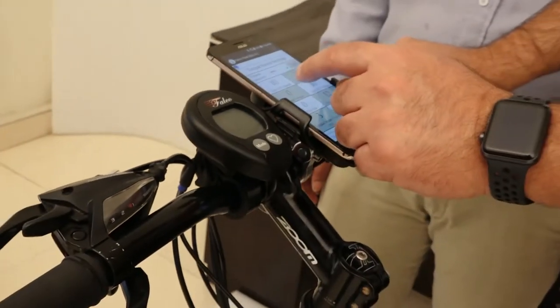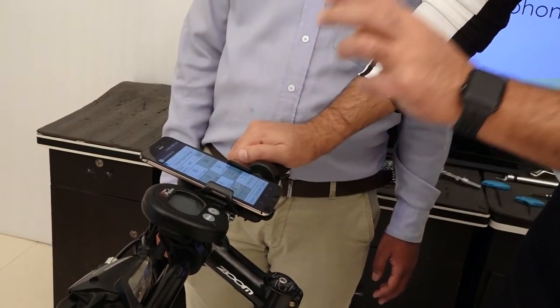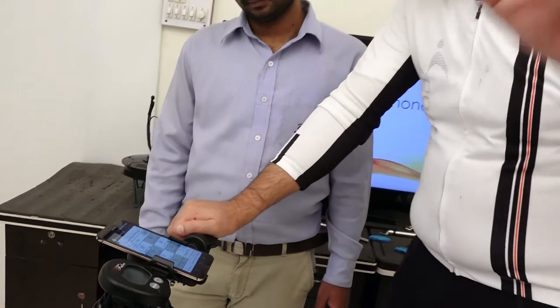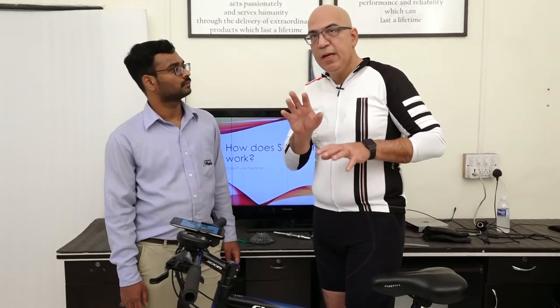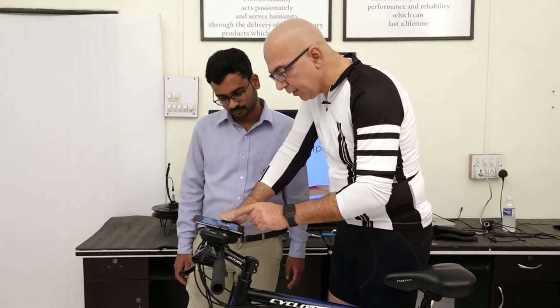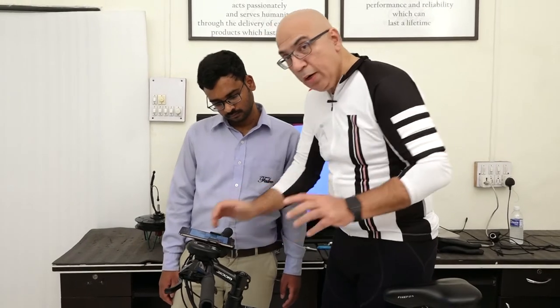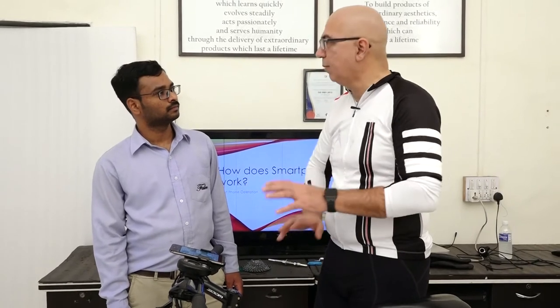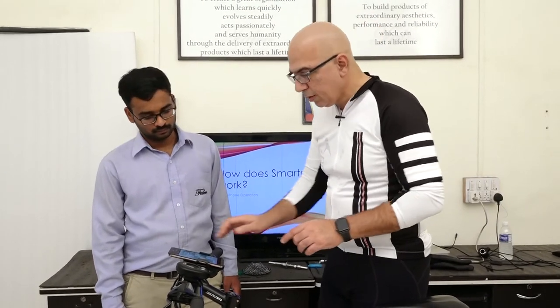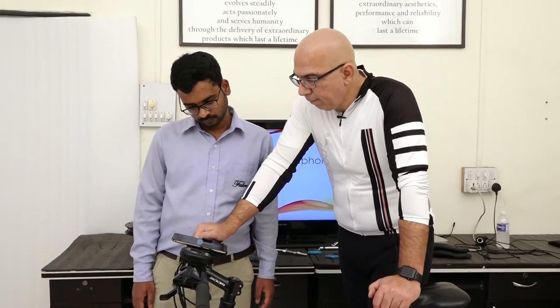These settings — turn on speed, turn on delay, base torque, turn off delay — are not as important today as they were three years ago, because then we didn't have the speed sensor. With these three settings — torque multiplier, dropout offset, torque turn-on — these allow for a lot more sensitivity to my push, so I can really feel the power of the motor. I'm going to broadcast this and have those settings as permanent for my riding.